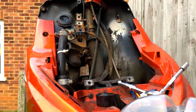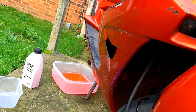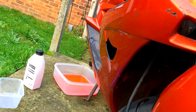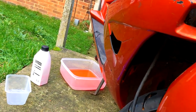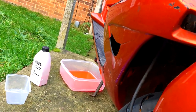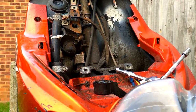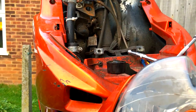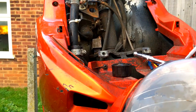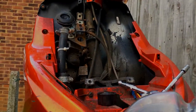Just reverse the steps exactly as I've just done: take that off, put your exit coolant pipe back on, tighten that right back up. Be careful not to split the rubber on the tubes though — quite hard to find these tubes where they don't make them anymore, unless you look on ped parts where you can get brand new ones. Then once that's all back on, fill it back up with coolant right to the top, make sure there's no air bubbles in there, then put your cap on and put your front panel back on with your screws — in my case cable ties.